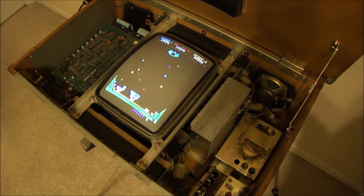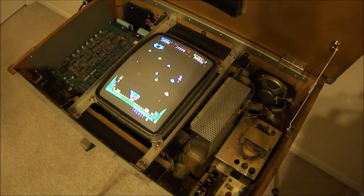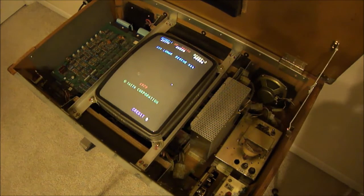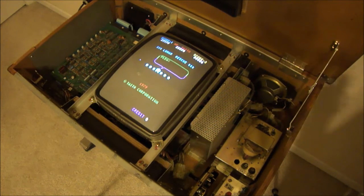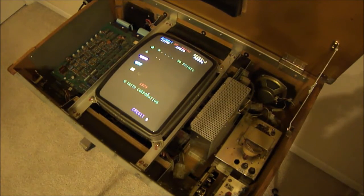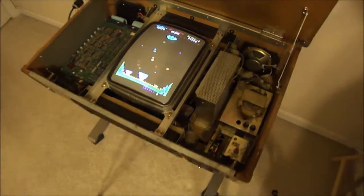So they would be running their game on 100 volts, which is the Japanese setting, here in America on the wrong setting, and we use like 110 to 120 here. It was kind of nuts because they probably could have been running that on the Japanese setting for at least a decade or so. But I fixed that up and changed it to the right setting.